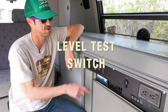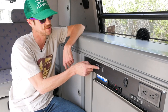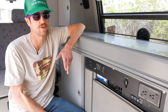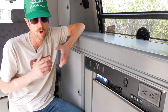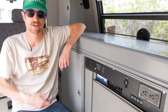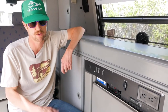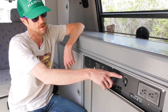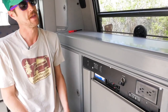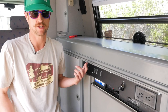Above the fridge is the level test switch that will show you the levels of your gray water — which is also the holding tank — your fresh water levels, your propane levels, and the condition of your camping battery. You do have two batteries in this car: the starter battery up front for the vehicle itself and the camping battery in the back. Both batteries are connected so that when you drive, the alternator will charge your camping battery as well as the starter battery. But when you turn off the car, the two batteries are disconnected — that way, if you did run down the camper battery, you'll still be able to start the car. Also on the control panel, you've got a 12-volt power outlet that works at all times off of your camping battery, and a 110 outlet that will only work when the van is plugged into shore power.